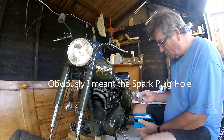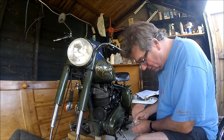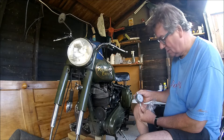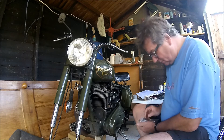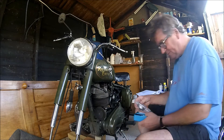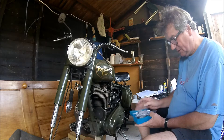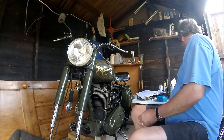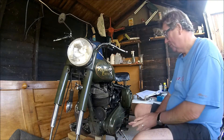So I went and bought a dial gauge — really impressive, very pleased with it — which you plonk into the spark plug hole and it really accurately measures for you. So we've sorted the timing and it's much, much better now. Still a little bit of work; it kicks back at me quite ferociously when I go to start it, so I need to do a little bit more on the timing. But basically I'm happy that it's all achievable — there's nothing really a problem there.